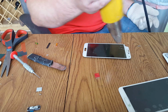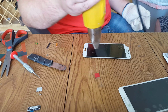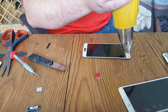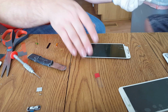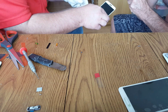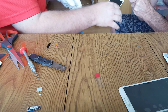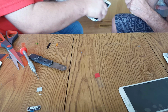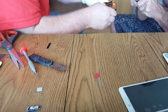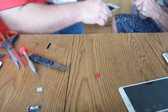We're gonna try to get this in the camera's angle. I'm gonna have you scoot closer. Nice and toasty, hot to the touch. Okay, come closer. We're right here. Okay, so we're gonna start slicing. Let's start on the bottom here, wherever I can enter. Make sure you angle towards the top of the glass and not the bottom of the LCD. It's going to be really hot to touch, so if you have a second glove, use it. Really hot to touch. Really glued on.